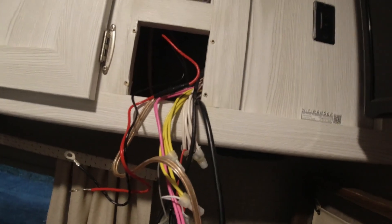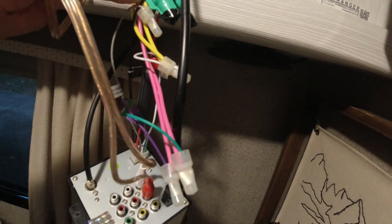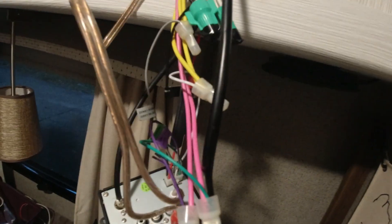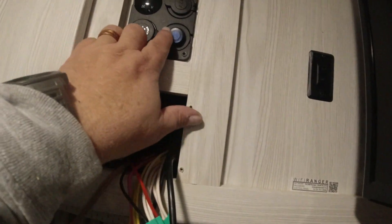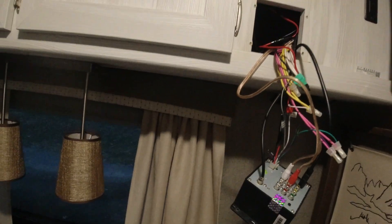The red wire is hot positive and the black wire is negative. I've got this hooked back up — here's the black wire from the stereo, and the red wire is down in here. The red wire goes to this one back here and the black one goes to this one. I did use a wire nut that had a hole in the top — I just put some tape over that. Those wire nuts work pretty good. We're going to go ahead and stuff it back in the hole. We've already tested it out quickly just to see, and then we'll get it back in and make sure the radio works.